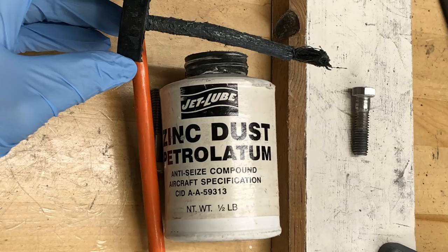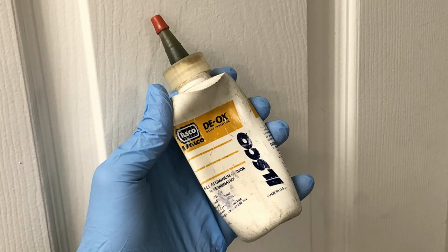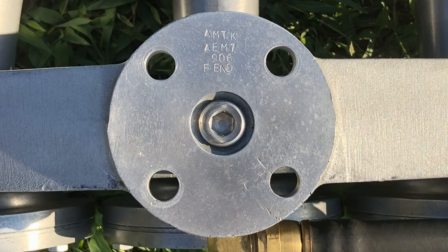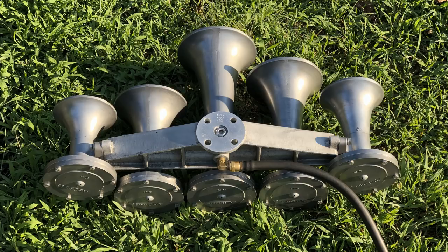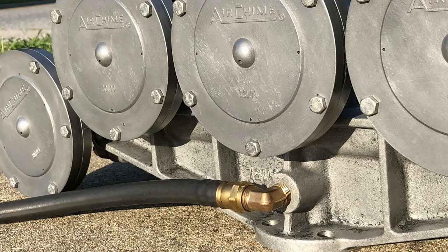When reassembling the horn, I put anti-seize on all of the threaded connections. I put deox on all of the mated surfaces to prevent corrosion from occurring. And on all the rubber parts, I use lithium grease. As you can see, I stamped the bottom of most of my horns with what locomotive they came off of. I was really happy with how this entire horn came out — it looks almost showroom quality, brand new finish on the entire thing. I replaced the pipe plugs with stainless steel parts and was able to reuse the original air line.